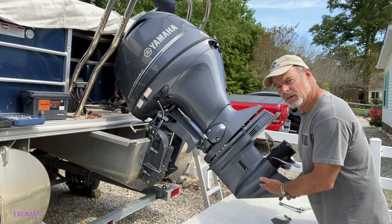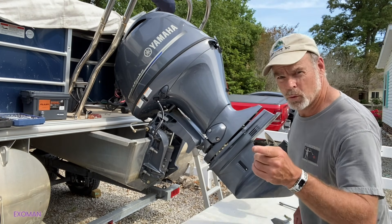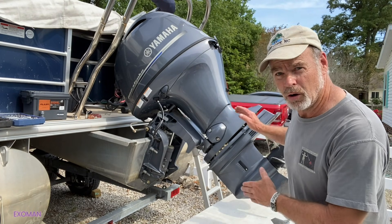Now I'm going to pull the lower unit. I have my table here to drop my lower unit onto. There's one more thing on my motor — a speedometer tube that comes through right here. Also make sure that your motor is in neutral before you remove your lower unit. You'll be able to see the tube right there — just disconnect that little tube. When you come back in with this, you're going to line this spline up and wiggle the shaft back up into the motor.